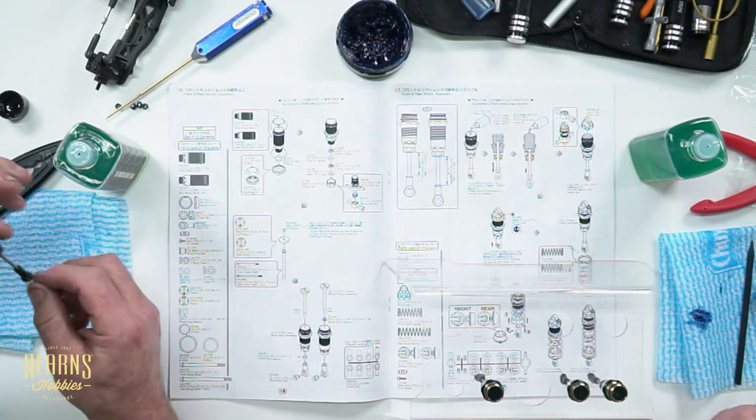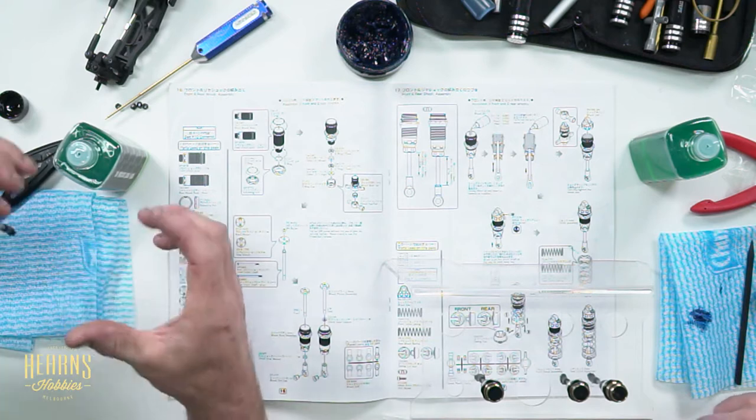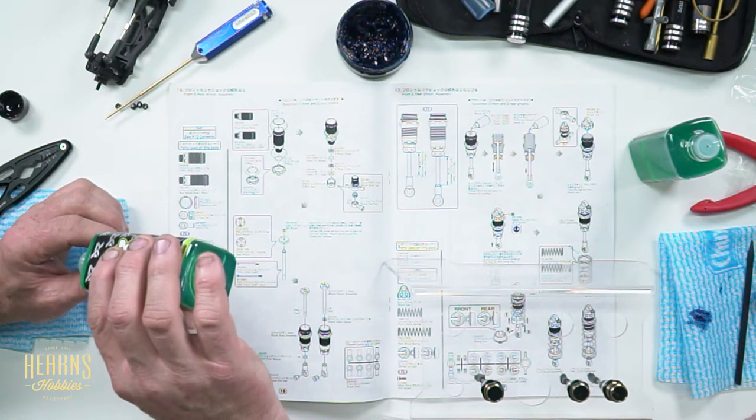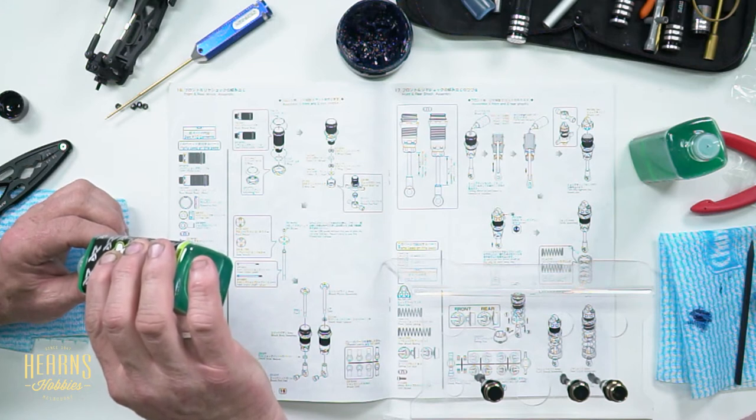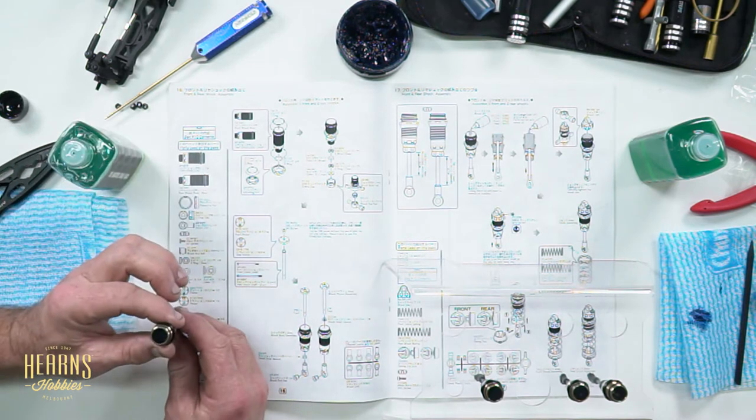Okay. So, the pistons are all the way at the bottom. You're going to have a cavity of air underneath it, which when you put the oil in, it'll hold. So just put the oil in. Yep. Oil going in. So just level with the top. Push up.